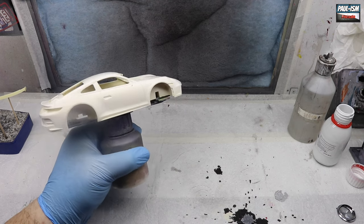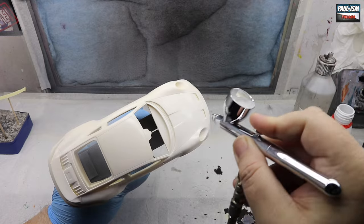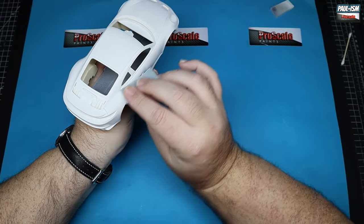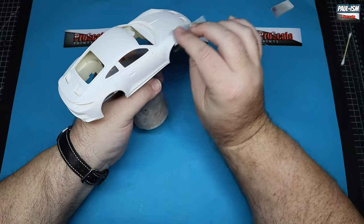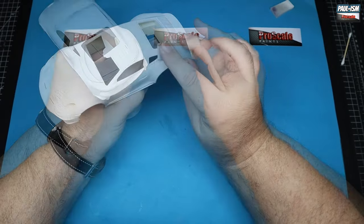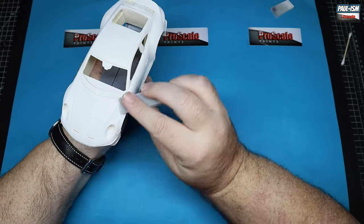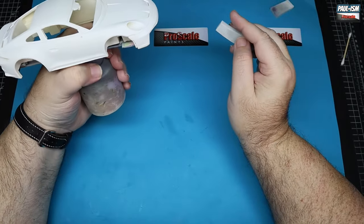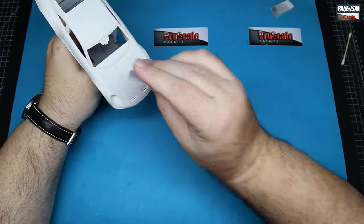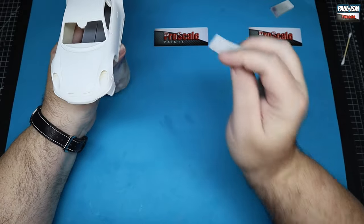Getting those final coats of primer into all the wheel arches, bumpers, grills, and lights — lots of nooks and crannies on these Porsches. Our microfiller primer dries with a slight texture, so let it cure for a good five to six hours at room temperature. Once dry, come back with a Tamiya 3000 grit sponge. All we're doing is taking the very top layer of primer off — the microfiller part — which leaves a beautifully smooth primed surface, ready for paint. Be very careful around edges — no pressure at all, just skimming the surface.